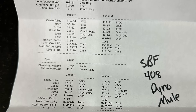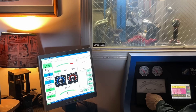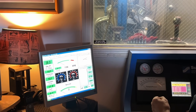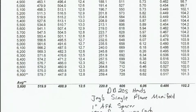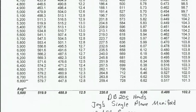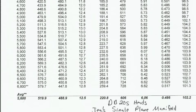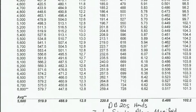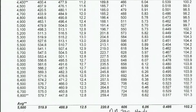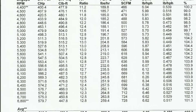Here's what it did with the Powell camshaft. It raised the peak horsepower up to 580, doing it at 6,800 RPM. I did try going further and it just did the same — it nosed over about there on this intake. Peak torque was 517 foot-pounds, so it's down one foot-pound of torque. It only increased the RPM for peak torque by 100 RPM, which is strange considering it brought peak horsepower up by about 400 RPM.